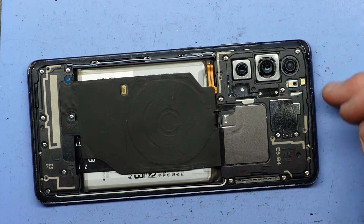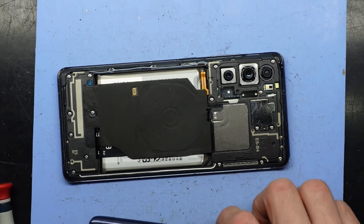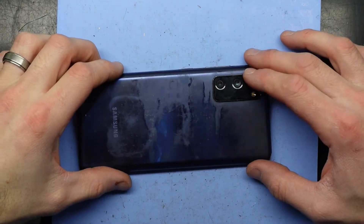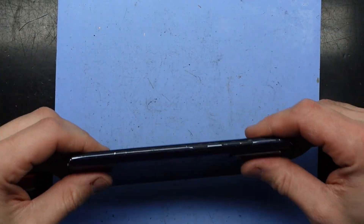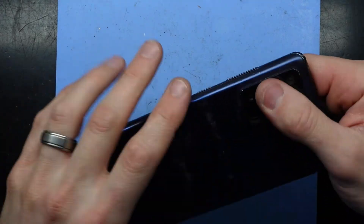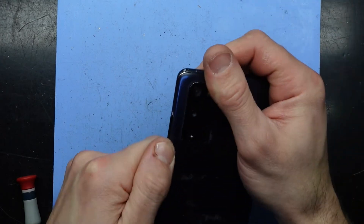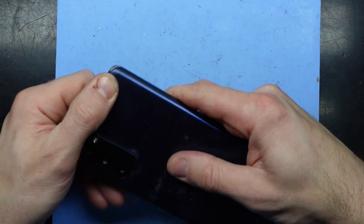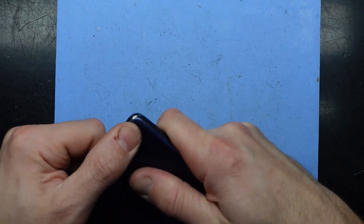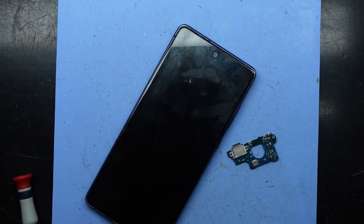Since this has been at 75 degrees Celsius on my heat mat, it should be right to put the back cover on now. Push down, lock it in, and just let that cool. Clamp it down with rubber bands. The frame already has the double sided tape from the factory — the glue should be holding that and bond it up a bit better from there. So that's how to replace the charging port in your S20 fan edition. Bye bye.